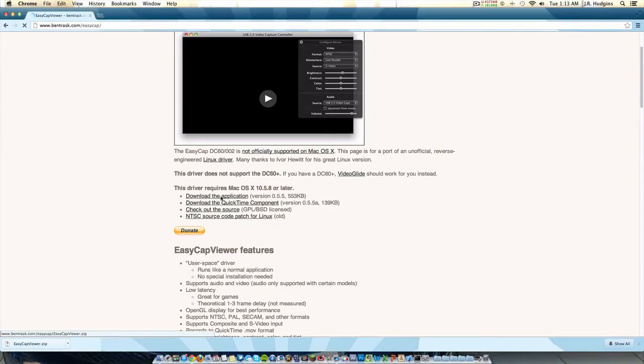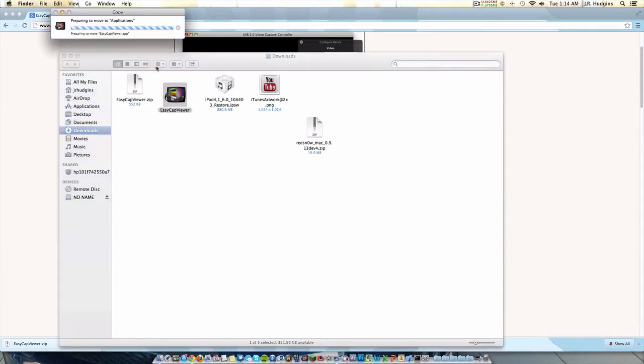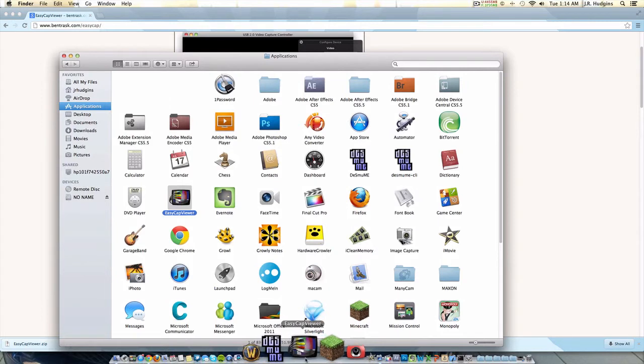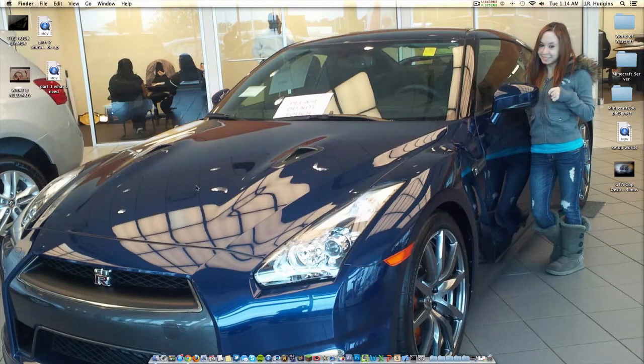Let's go ahead and click download. The application is not very big - it's only about half a megabyte - so it's going to download to your computer. Show it in Finder. You're going to see it as a zip file; unpackage the zip file and you'll get an application in your downloads. It looks like a little TV with AV cables and an S-Video cable. Drag that into Applications. I already have it in my Applications folder, and I dragged it onto my dock. The link is in the description for you guys to download EasyCap Viewer.